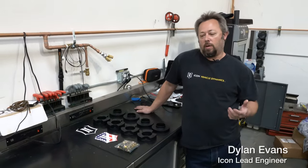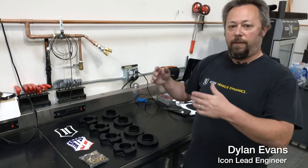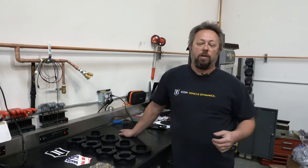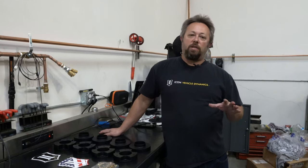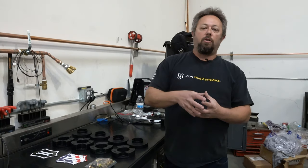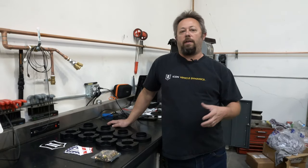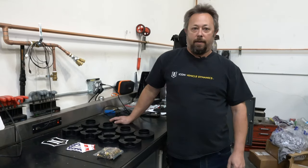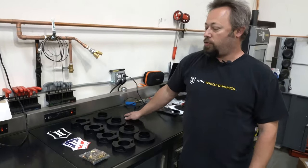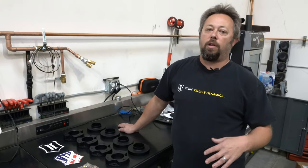One of the things that's interesting about the Bronco, as opposed to a lot of other vehicles out there, is it's IFS in the front and solid axle in the back with links. But this vehicle is different because it's got a full coilover strut assembly from the factory front and rear. On a lot of other vehicles you have a separate coil and a separate shock, but the Bronco is integrated both front and back. So we are treating the rear kind of like you treat the IFS front, but with some different parameters to maximize the droop and prevent tires from rubbing.